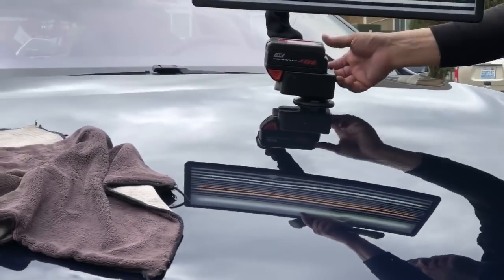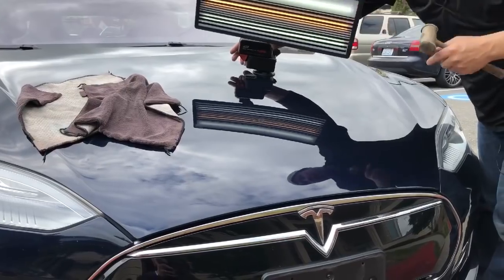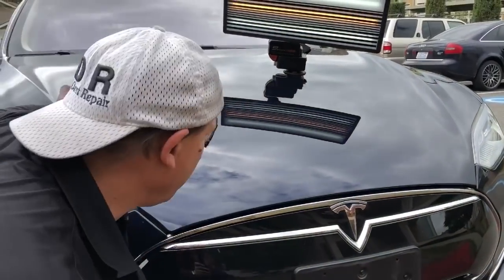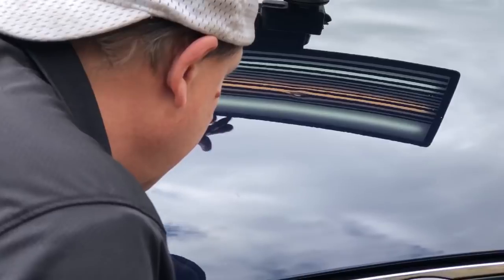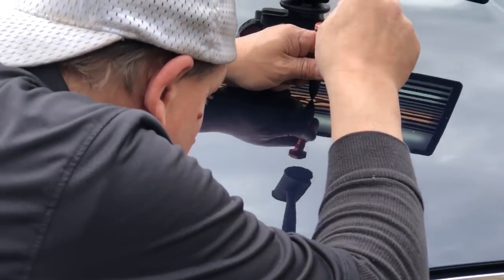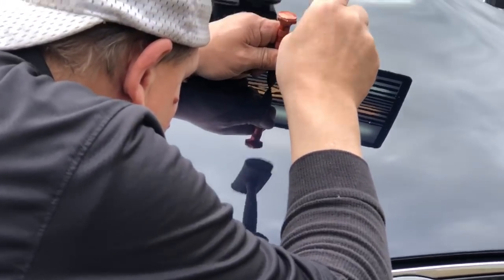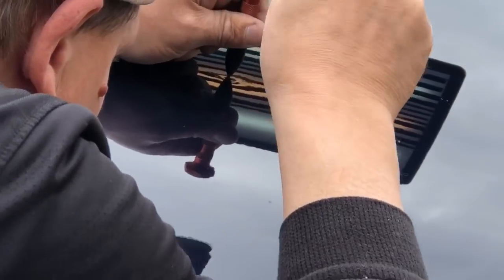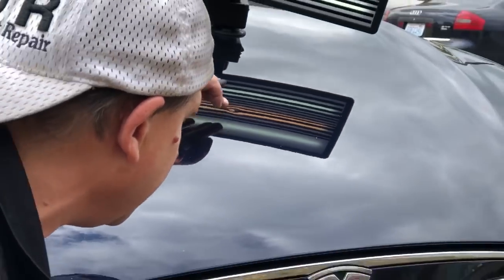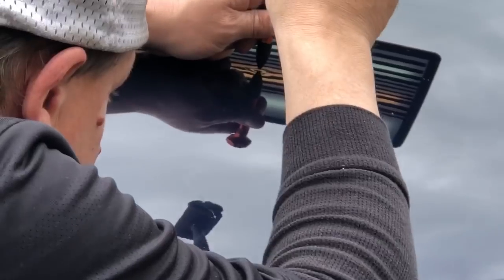So I can lift this board up, bring it a little closer. Obviously the smaller dent is a lot closer to being out. So I'm pretty much focused on this one right here. And what I'm seeing now when I look in the fog is it's not really crested yet, or anymore. Got this last little bit right here. Now these are some pretty severe hits, guys, but you see right there that tightening out, and we're almost in business.